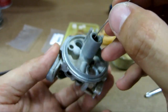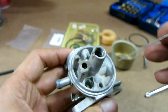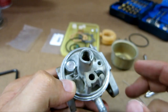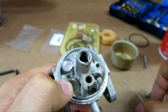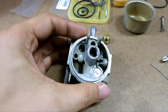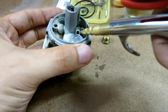Here is the main jet right here. At the main jet, you just poke through it. I'm going to poke through it again and go through all the passages to make sure there's no debris. Now since I know there's no debris, I'm going to take some carburetor cleaner and spray through those passages to make sure they're all cleared out. I finished using carb cleaner and sprayed through all of those locations. Now I'm going to use the compressor and make sure all the passages are clean.